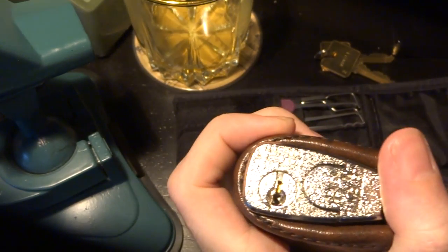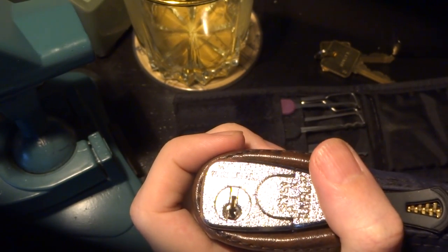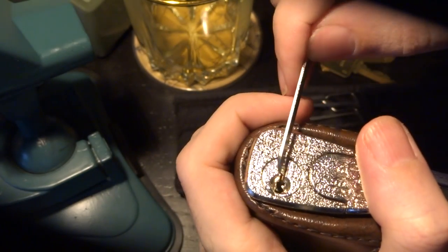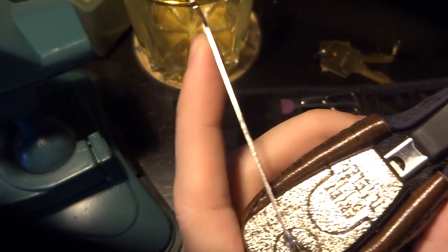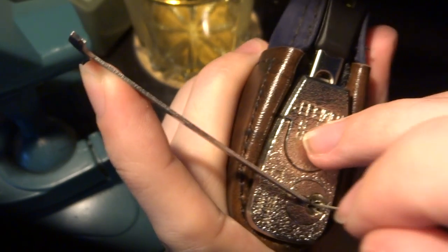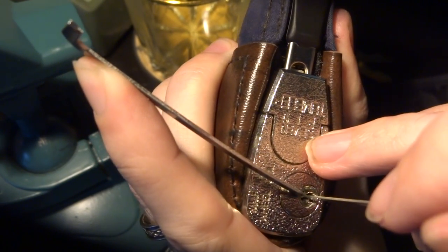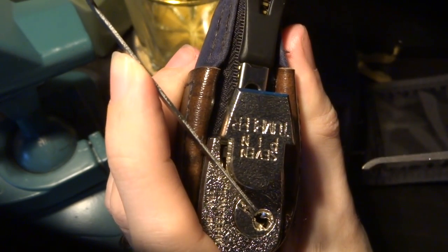So let's say you've lost the keys, or as I've done once or twice, actually locked the keys inside. What we're going to do is take our Peterson pry bar light — stick one end in there; the full pry bar is just a little too wide — and take our flat-tipped hook, reach in there, feel around... and look at that. Seven pins and we didn't even have to pick them all, and it's open.